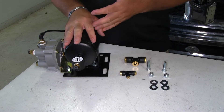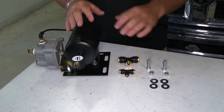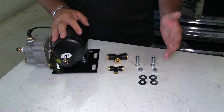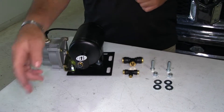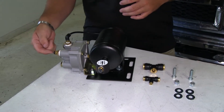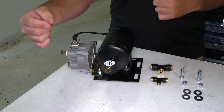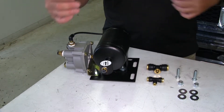This is going to be our tank for our air. These are going to be our T-connections for our airlines, and this is our hardware to mount this wherever we choose. You can change out the hardware — put bigger washers, longer bolts, whatever you need. Here we have our supply air that comes in and fills our tank. Here we have our metered air. We're going to have a line that comes off the bottom that runs to the back of the RV and goes to another L-bracket. That's where your hose from the front of your towed vehicle to your RV gets connected — that's how the air from the RV when you apply the brakes is being sent into the towed vehicle.